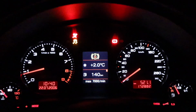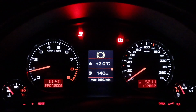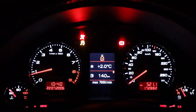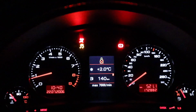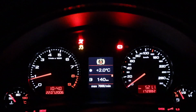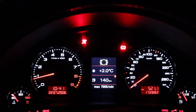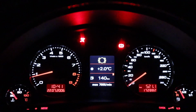Now I'm going to push it. That's half traction off. Now I'm going to hold it. I'm going to push it and hold it for, I think it's somewhere between 5 to 15 seconds. We'll do 10. And it should then go on solid once I let go, which is full traction control off. My favorite mode. So I'm holding it. And we'll let go now. Oh, it did not. Uh-oh, see, now it's acting up again.